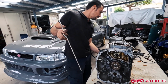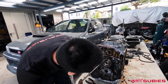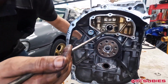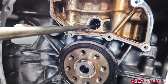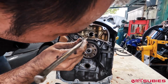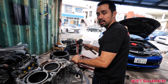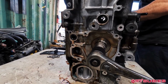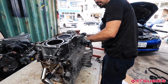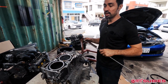What I'll show you is if you have a newer style model, what you can actually do makes it a lot easier. I'm kind of cheating, but trust me, you could do it either way. You rotate it and look at the wrist pin from this side. Typically this rod would be in the way a little bit, but because I've taken the wrist pins out, you can slide it over. You usually have less room than that. You slide it all the way through the edge and check over here to make sure it's aligned. On this side, you just take this and start tapping it, and then it'll start coming through on the other side. Sometimes it flies out, and you can pop them out that way. You can do that on all four of them without having a hook.